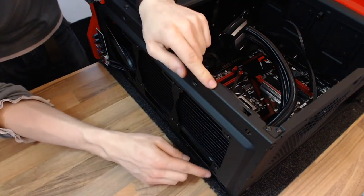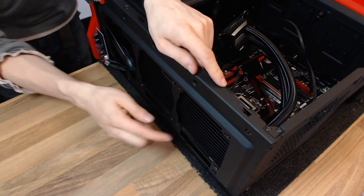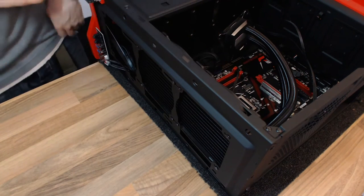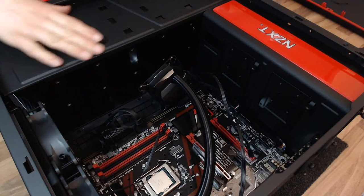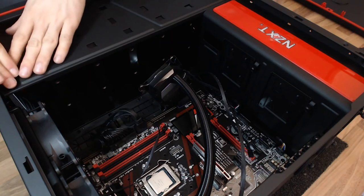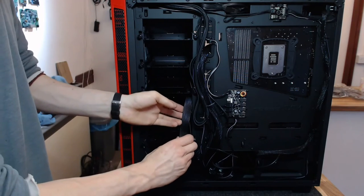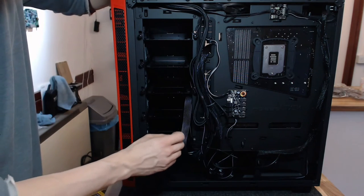Should I want to, I can also fit a 280mm radiator using the extra rails for 140mm wide fans, and that extends all the way up, so you can have a huge long water cooling radiator there. If you removed some of the hard drive trays from the cage, you'd be able to fit all your water cooling components in there as well — very versatile despite having this huge cage. Our H440 is doing us proud so far: all the hardware is in and it's accommodating everything comfortably with no fuss. We just need to fit the drives and we're about ready to run.